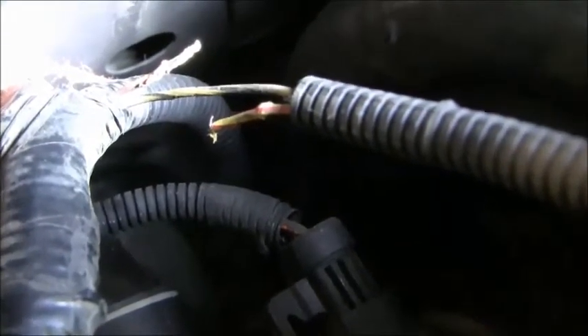This is the end of the wiring harness coming down from the engine compartment — it plugs into the connector that goes out to the ABS sensor at the wheel. That's the one I checked for resistance at the two pins. I found the severed wire up on top. I'm going to use this piece of string so I can fish it back down after I repair it. Now that I've pulled the wire up, I have a lot more working room. I'm going to solder that wire back, use some heat shrink tubing, and then pull it back down into place.